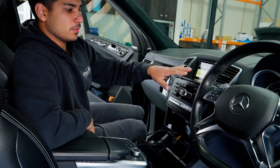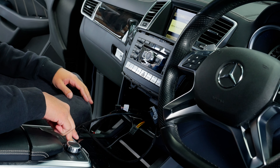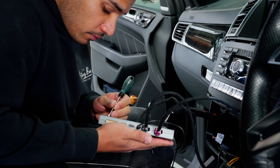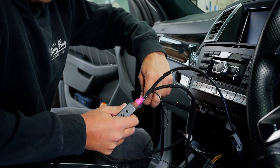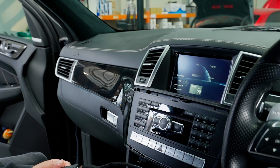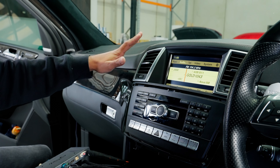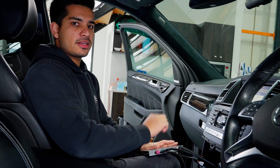Good sign — the original screen is working, which is perfect. On the control dial, press and hold the back button to switch modes. We had a black screen initially, so we unplugged the module, checked the dip switch settings, and plugged it back in. Now we're into Apple CarPlay. There's no phone connected yet, but the NTG controller is working and the screen works. Press and hold the back button and all original features work — nav, audio, phone — you haven't lost anything.